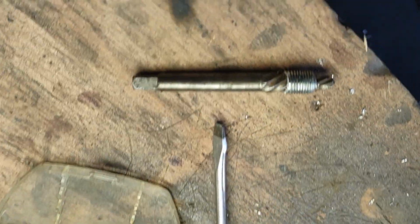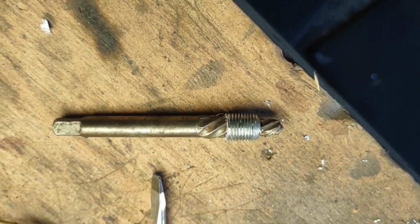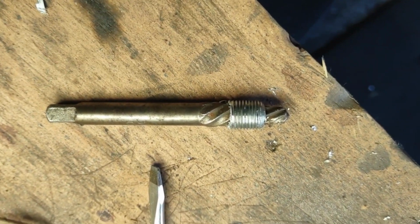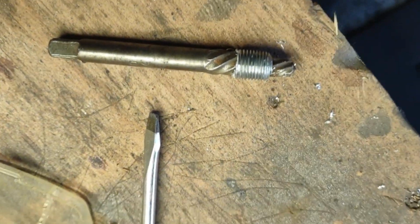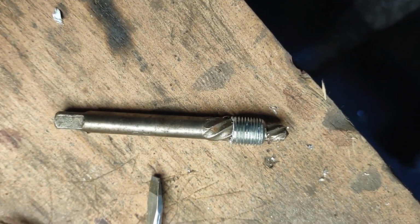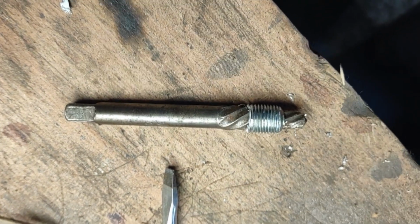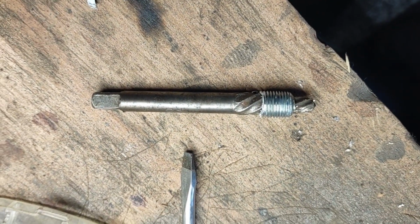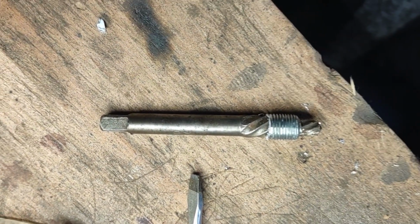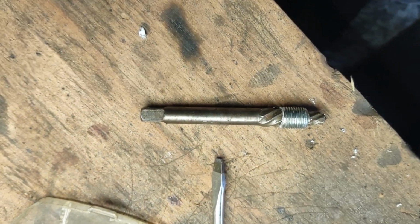So after drilling that out, I did get an easy out in there, and I did manage to get it out while Junior was tapping on the backside of the easy out while I was putting even pressure on it. You got to watch out putting easy outs in because they're tapered, and this is like a steel plug going into an aluminum or a pot metal housing. If you expand it too much, you can blow it apart and actually crack the carb, but luckily I am pretty sure we did not do that this time.